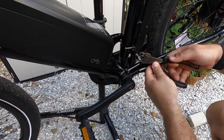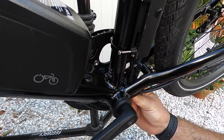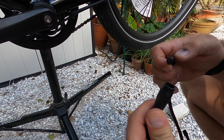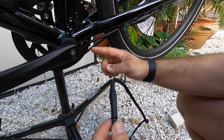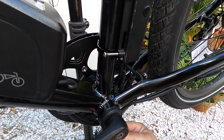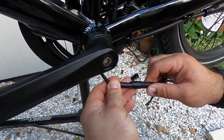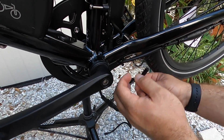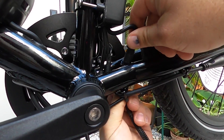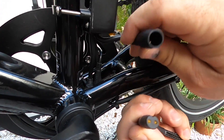When I get to my bike, I'm going to clip this zip tie and then look for essentially this wiring setup — I can see it right here. I'm going to unplug them, and you can see that this one is matching here, so we know we got it. Then I'm going to plug that in and take this one and plug it in right up here. You can see it. Now there is a notch on these, so you just want to look out for that.